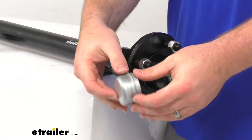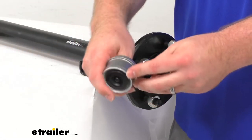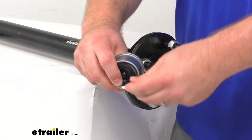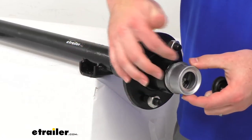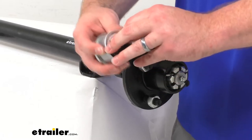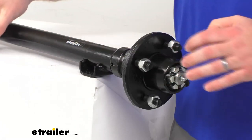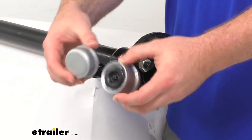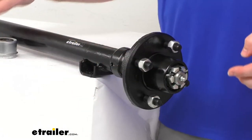With our caps, you are going to get one solid cap that you're probably used to, but then you're also going to get the cap with the removable plug. Just use a flathead screwdriver and pop that open — that will give you access to your grease zerk so you don't even have to pull your cap out. It will allow you to very easily access that so you can get grease pumped into that cavity. You get one of those caps for each side, so both options. If you don't want to use that grease zerk, you can cap it off with that solid cap.